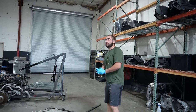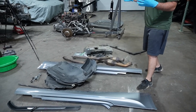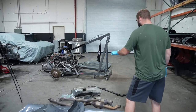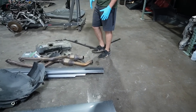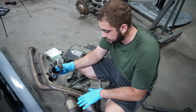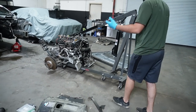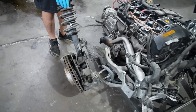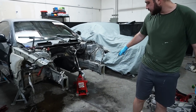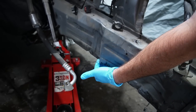After hours and hours of work on the 335is, what you see right here is everything we had to remove just to get the engine out. We had to get the side skirts off, both fenders — which are junk, thrown in the scrap pile — the door seals, the wheel liners. These are the secondary cats. The previous owner had clamps throughout the entire exhaust, so I just had to drop the two mid pipes. We're going to move the ECU and then obviously the main piece — the transmission, engine, and suspension. I'm about to separate the subframe from the engine because this subframe is completely mangled.